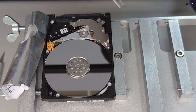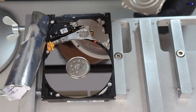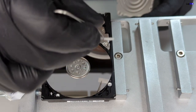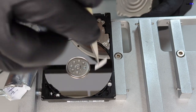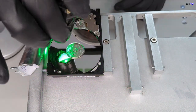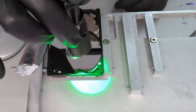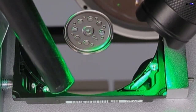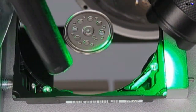We're going to be doing an inspection. We see the arm is parked, not on the platter itself. We're going to be checking this filter in the corner first to see if it's dirty — it looks to be pretty clean, so we're going to put it back in. Now we're going to be inspecting the platter. We're using this special green light that's going to be showing debris or any scratches or micro scratches. We see there's actually some contamination to the platter here, and we're going to be cleaning it. We need to be very careful, especially in this process.